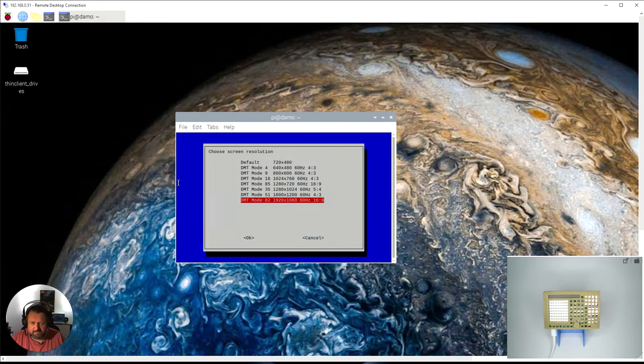The resolution we have to set it to is DMT mode 82, 1920 by 1080, 60 hertz, 16:9. Now obviously mine was already set up the other way, otherwise I couldn't be remote desktopping into this to record this video, but yours may be up here at the default. So you need to scroll down until you get to this mode 82 and make sure you have that.